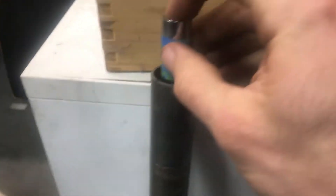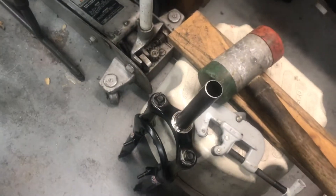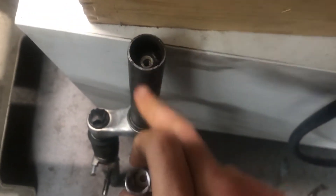The depth to which I will be hammering it down is 15mm, and you don't have to be super precise with this. I've already got a fork right here that has a star nut in it — you can just kind of see that we'll just keep on hammering this thing in until it goes right down in there. The main point is you're just trying to hammer it in so it's flush and perpendicular to the steerer tube, because you don't want a crooked star nut. And if you screw up, worst case scenario you can just hammer this thing all the way down and then hammer in another one because they're pretty cheap.